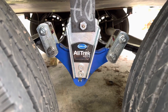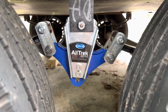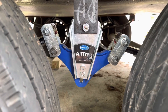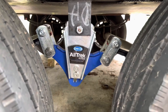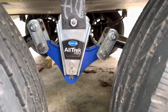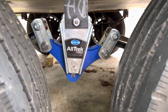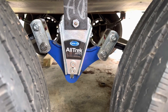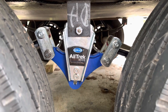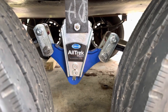I have a few tips for you guys that are going to be doing this yourselves. Tip number one: don't do what I did and reuse the bolts — buy new bolts. Make sure you have the new bolts on hand before you do this project. I destroyed the tip of this bolt and ended up having to cut the tip of it off with a sawzall in order to get an old nut to re-thread because I destroyed the new nut. But since I used my old bolts, I used threadlocker on all of the nuts, and they seem to be good — they're torqued down, they're pulled into the shackles correctly, and they're not coming out.